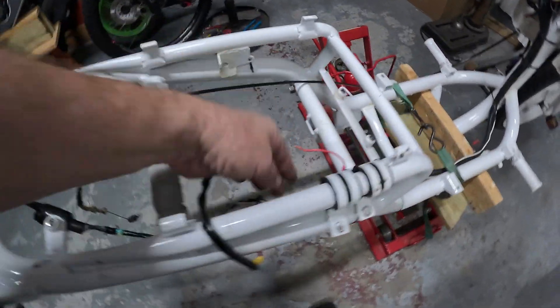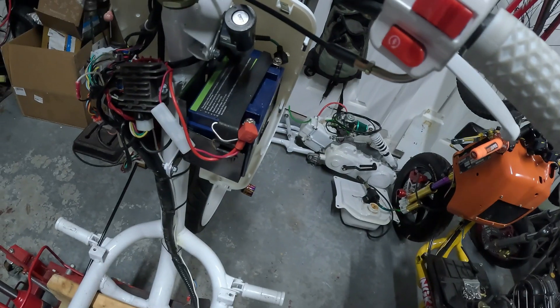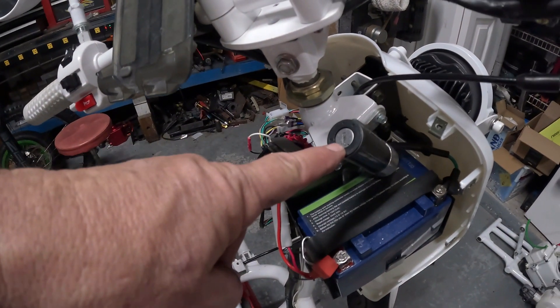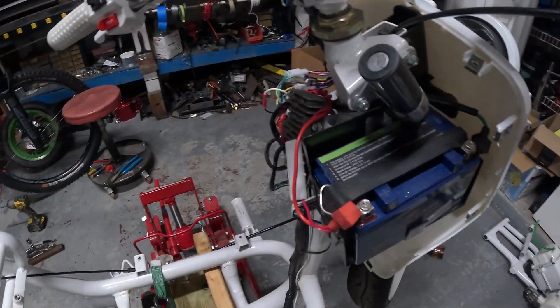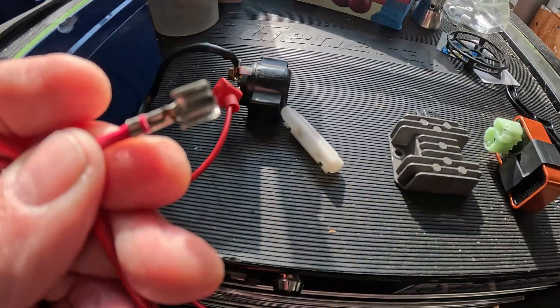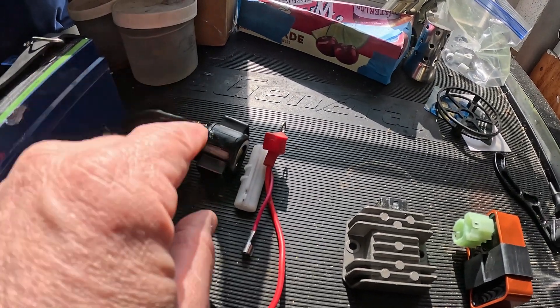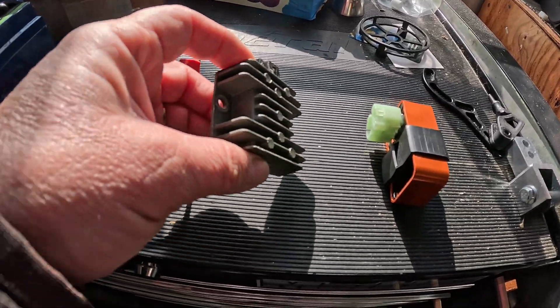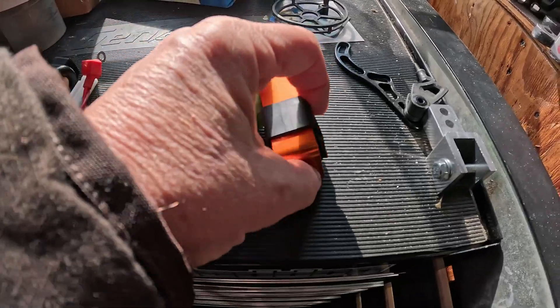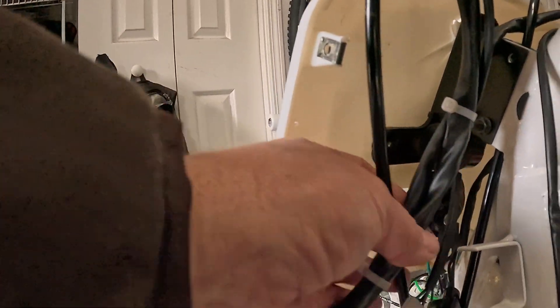I might as well leave all the wiring bundle connected. I don't need the regulator, I don't need this relay, I don't need a CDI, I don't need a battery. We will use the key switch so we can turn it on and off and lock it just like normal. What I pulled out: the battery, the relay that goes to the positive part of the battery, the voltage rectifier and regulator, and the CDI — those all came out. I even took the battery holder out. I left the key, the horn, the lights, the blinkers, everything.